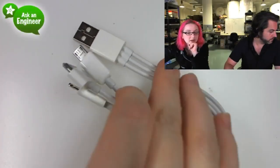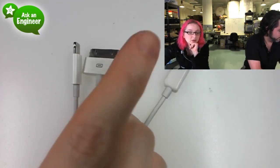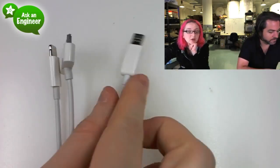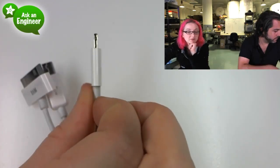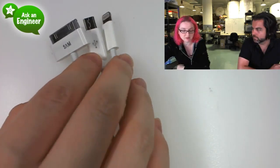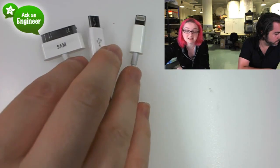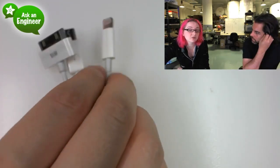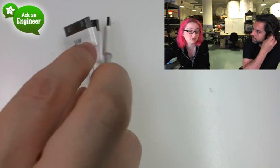This is a three-in-one cable. You have USB here — this is your standard USB connector. And then on the other end you have three ends: you've got your classic iPod and early iPad and iPhone 30-pin connector, a micro USB — almost every other phone uses micro USB — and Lightning, which is the iPhone 5 and iPad connector. To be clear, you should only charge one device at a time. The iPod and the micro USB cables are charging only — only the power and ground lines are connected, the data lines are not connected on the inside. However, the Lightning cable does have data connected to it.